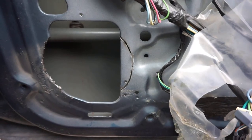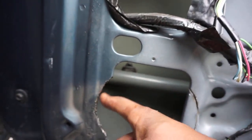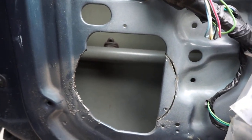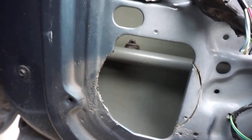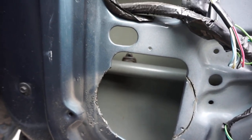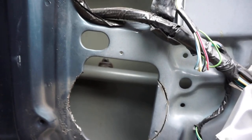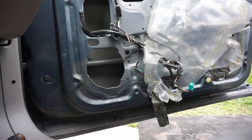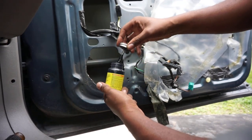The air compressor ran out of juice - I had it wide open almost the whole time. Got the left side out and I'm almost done, just gotta cut that little middle piece out. You could come in with a grinding wheel and smooth it down, but when I put the liquid electrical tape on there it rubberizes it so it's not sharp and jagged. Plus I think it acts as a nice little dampener between the speaker and the door so it's not metal-on-metal contact. Going to put it all the way around the surface.